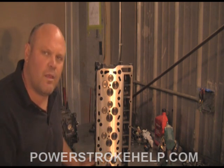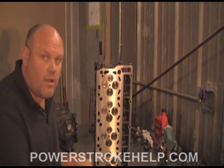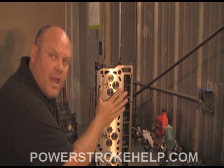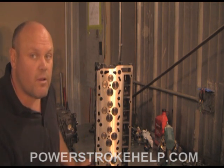Take your heads to a quality machine shop — a machine shop that works at a level of precision like BMW and Mercedes. It's not just Joe Bob's tractor shop where you throw this thing on the belt and sand the thing flat. You can't do that. You've got to have a very high level of precision. You can only take 12 thousandths off of this head. Ford Motor Company says none — can't take anything off of it.